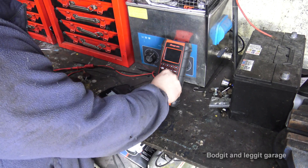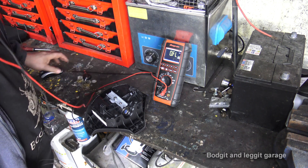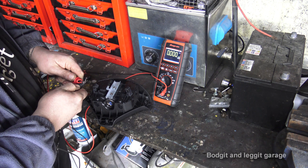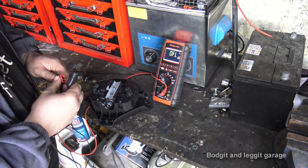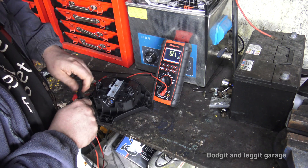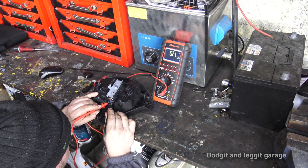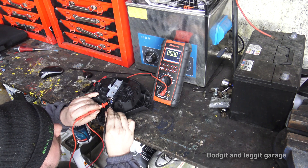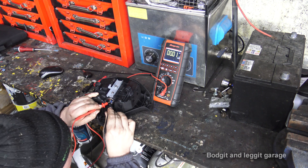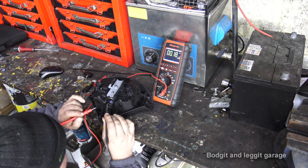What you need to do is turn your multimeter onto your ohm setting. Now if I was to test it now — I'm going to clip these leads on — it's not going to work because we've got those two grounding pins touching our connections. As we can see, that's essentially what we've got, which is no good. We've got our grounding pins in there so we know that's why it's giving us a false reading.